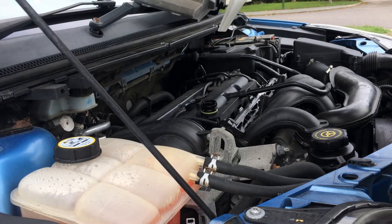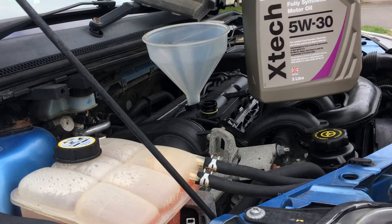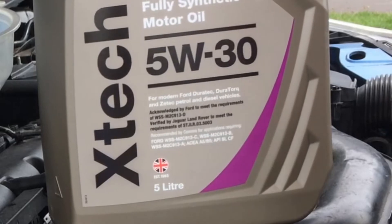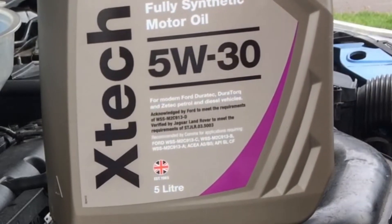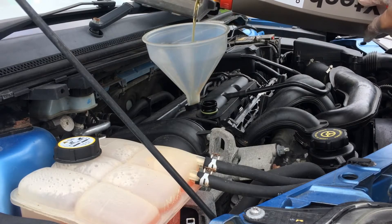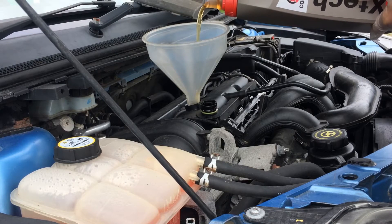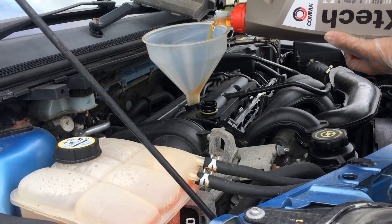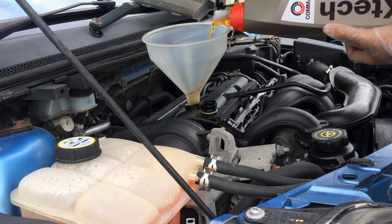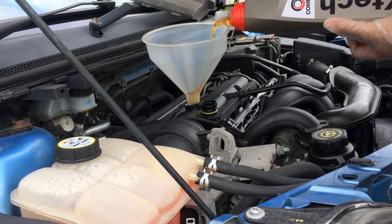Now it's finally the moment of filling the car with oil. For Ford, this is the 5W-30 grade oil. But it's not just any 5W-30 — this one is to Ford specification. So if you find a 5W-30 oil for this car, make sure it is to the Ford specification. The grade is not everything — it's the grade and the formulation. Of course, if you are doing an oil change, make sure you put the sump plug and the oil filter in first. You don't want all the oil to come out the bottom — otherwise you'll have a messy driveway and a whole lot of trouble.